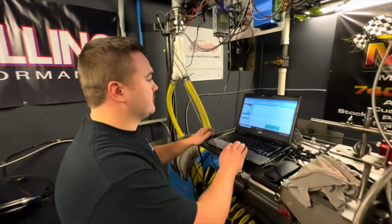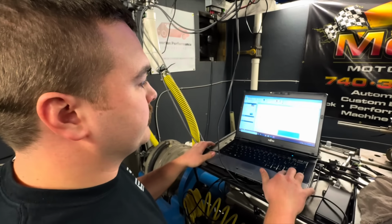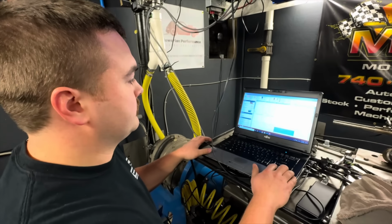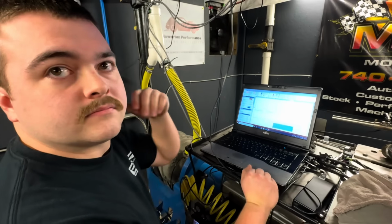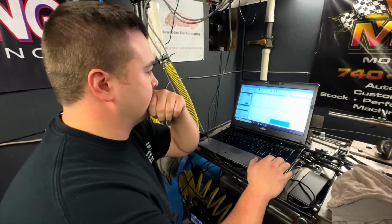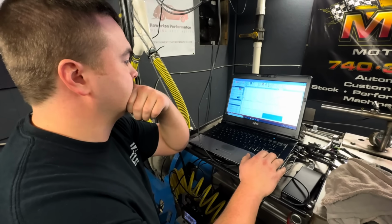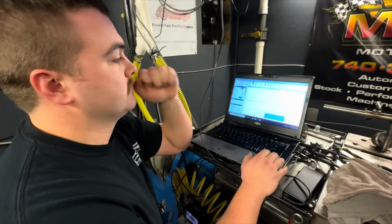What do you got now? Brought the air fuel down to about 12.8, and they're almost identical bank to bank. All right. So now I'm happy with the fuel trim, and the horsepower picked up just a little, but it picked up torque throughout the entire range, and so I feel like we're in real good shape now with the carburetor tune. Let's try and add 2 degrees to it and just see if I can't crack 450.